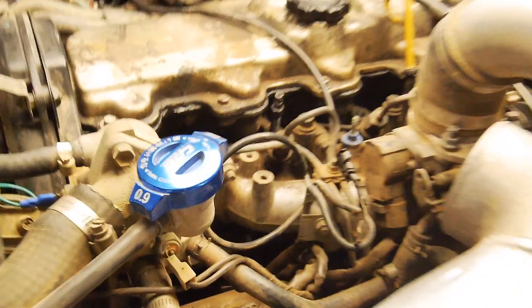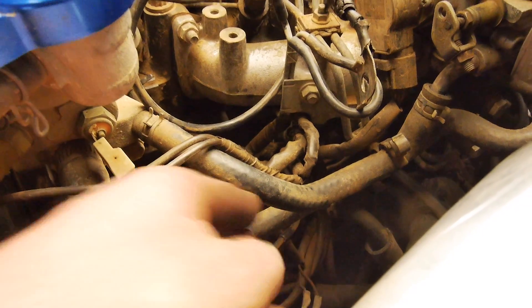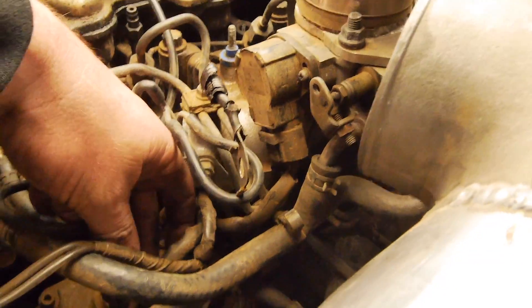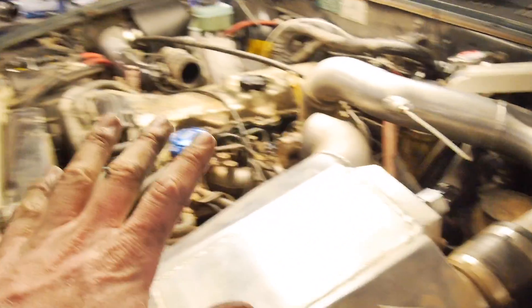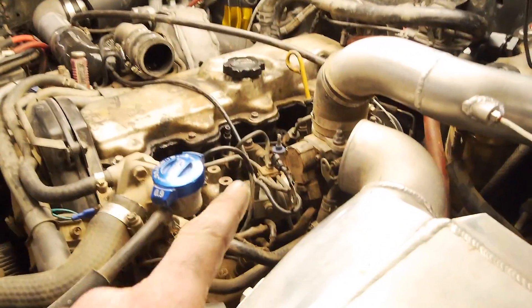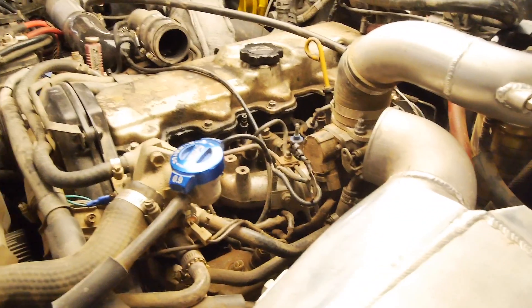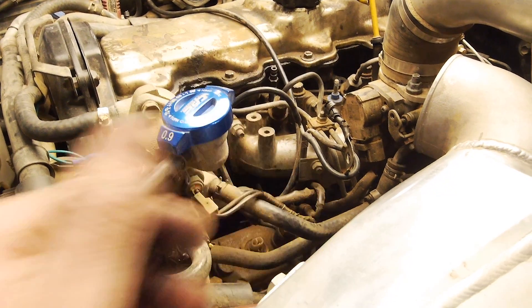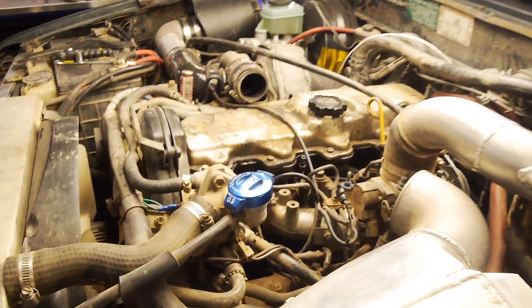It's actually really, really simple. One thing that needs to be done — which is very important — you need to deactivate the diesel pump. On this car in particular, it's this blue plug that I'm pointing to on top of the injector pump; that is the fuel shutoff valve. So I'll just unplug that. Now we're basically free to crank the engine and we're not going to be spraying fuel everywhere. For those of you with a mechanical pump, it's basically the same thing — there will either be a plug or some kind of connector to the shutoff valve on the back of the pump. If you don't know, check your instruction manual for the engine or the vehicle, or go on the forums, ask on Facebook — it'll be pretty easy to work out.